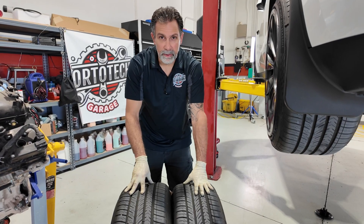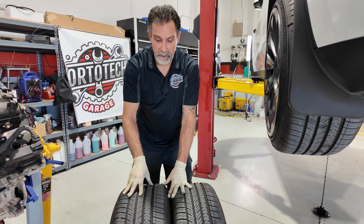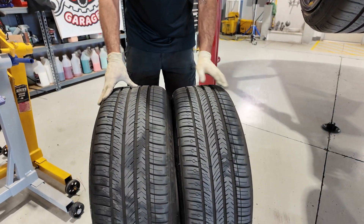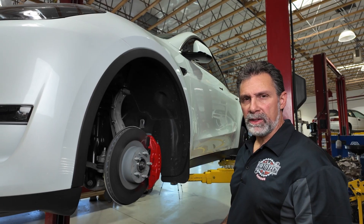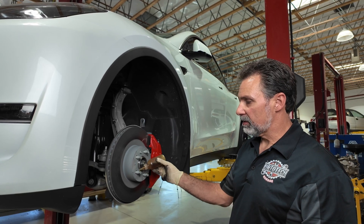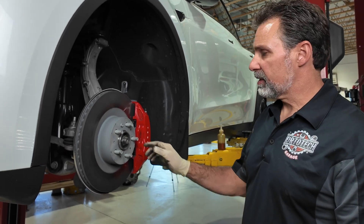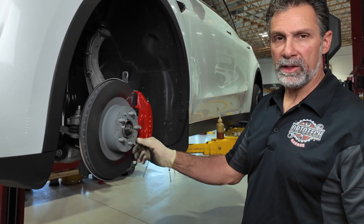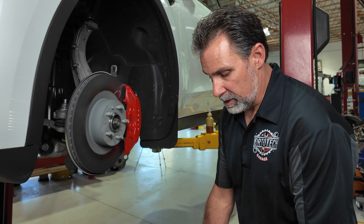In the middle of this rotation — going left to right — I thought it'd be a good idea to stack the tires side by side before putting the wheels back on. I told you the rear tire is wider than the front tire, and you can really see the difference here. This is going to cause a real problem if you try to go front to back. If you've watched my other videos, you know I like to put a little dab of oil on the threads — it helps lubricate them, and if you live in an area with a lot of rust and corrosion, it helps your lug nuts last longer and saves the threads on your lug studs.